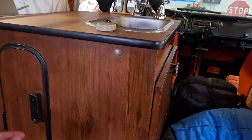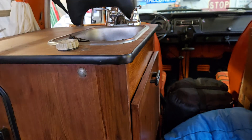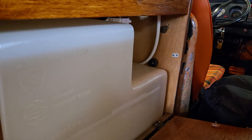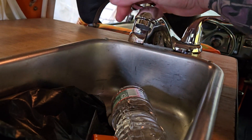Other things in the bus - this is the standard interior for the '75, but I did add different things. I installed a hot water heater that runs off 110 - it doesn't run off the batteries. That's the water pump for it, all plumbed in with PEX, and I actually ran a drain out the bottom. The original sink just had a little 12-volt pump that ran inside the tank - it was a mess when I got it and not a great outlet, just kind of small. So I installed this with that pump assembly and a real big faucet.